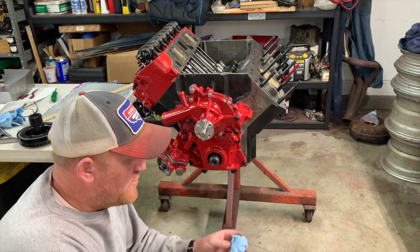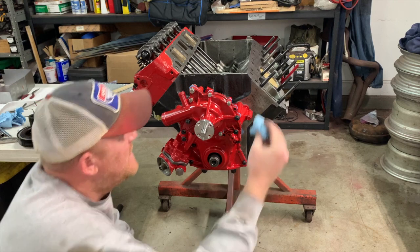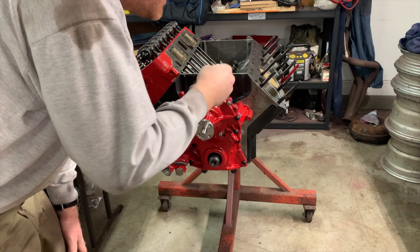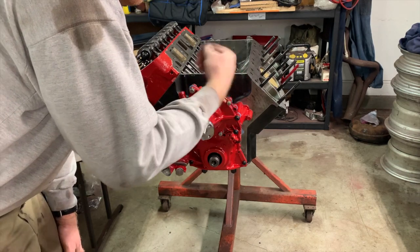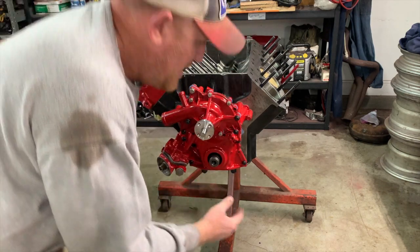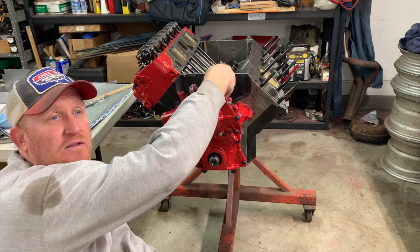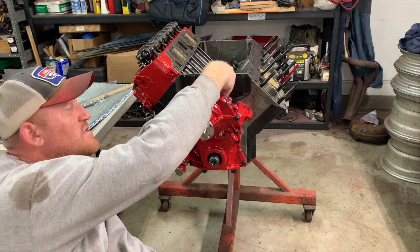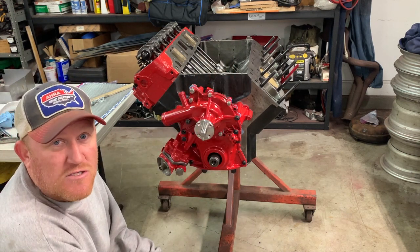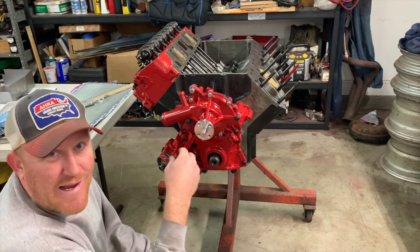In the next step I usually take one of these garage paper towels, wad it up, and drop it in the distributor hole. The reason is that if anything falls down in there, you want to keep it from falling into the engine - it could get stuck in there and you'd have to disassemble this whole thing just to get it out. I drop a paper towel in and stick it in until there's at least about an inch sticking out. Even if it got pushed in, you could probably reach in and grab it.